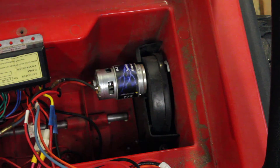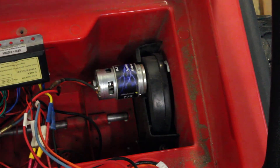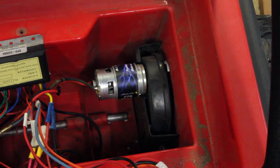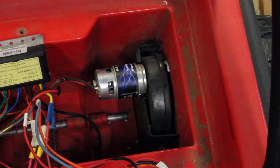On to the two motors. The original setup just left the stock 12-volt motors in place and ran 24 volts through them. That worked for a few months until one motor died and the gearbox got stripped — partly from the rubber on the back tires. So I ended up buying two 24-volt motors and a new gearbox from ML Toys — I'll post a link in the description. They're the 775 model.